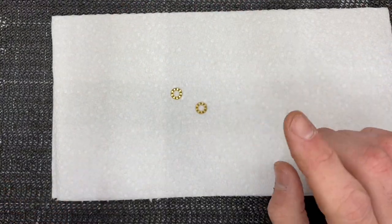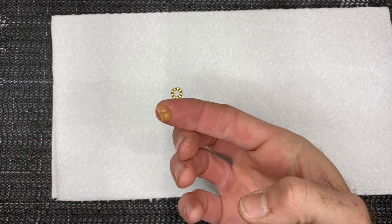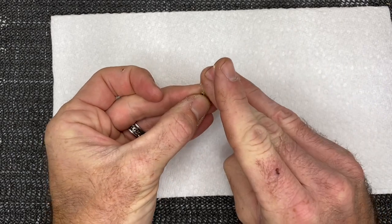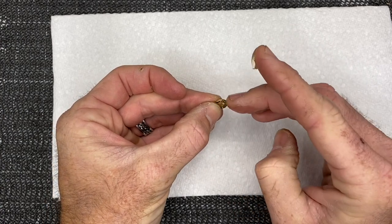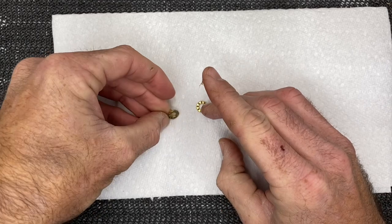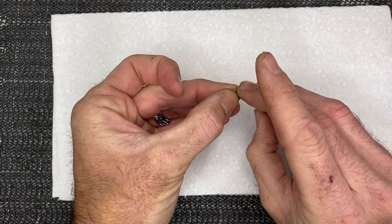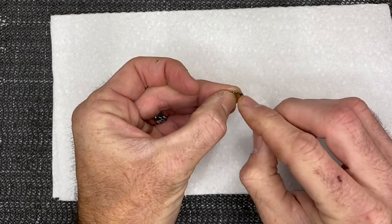First step is the tail assembly. I wanted to touch on something real quick — in multiple build videos I always say the bearings are pre-loaded. To grease your thrust bearings, take a little bit of micro lube and shove it into the bearing. If you've ever packed a wheel bearing on a car, same thing — you're shoving it in, going around, doing both bearings, getting them pre-greased and ready.